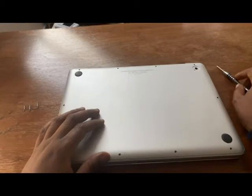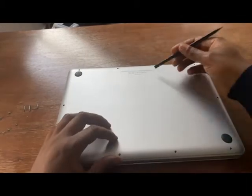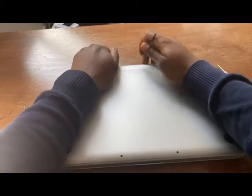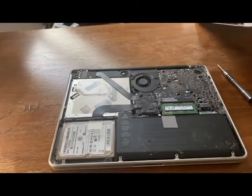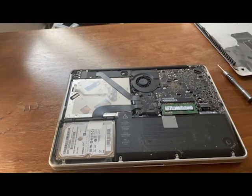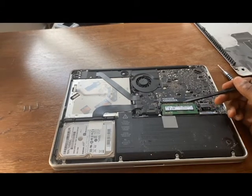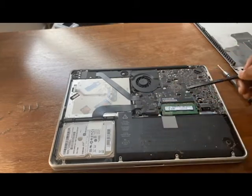So that's out of the way. What we'll need is the pick — this is basically to open the chassis up. There we go. So there's the inside. What we'll be doing exactly is removing these RAM cards here, which are already pre-installed, and also swapping this HDD for an SSD.